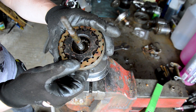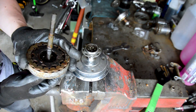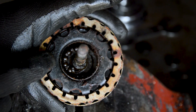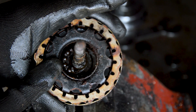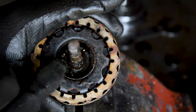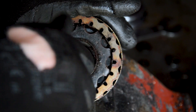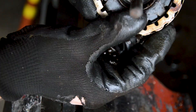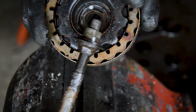Don't start pulling this apart because it will screw up the dynamo. But inside you can see the reason why it was gritty and pretty much seized - the bearing race has just collapsed, which is actually the same problem that RJ had on his. There goes the race - and then it pops out.